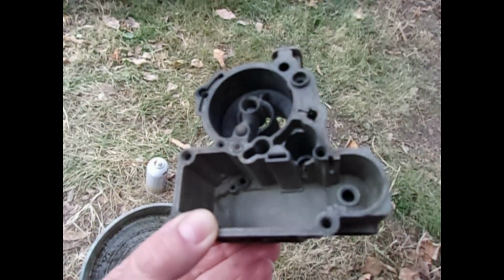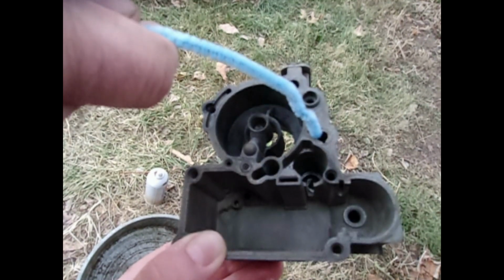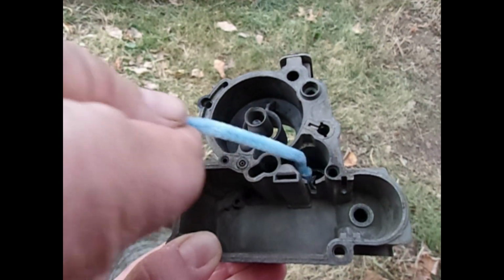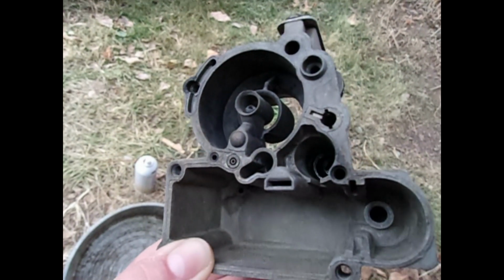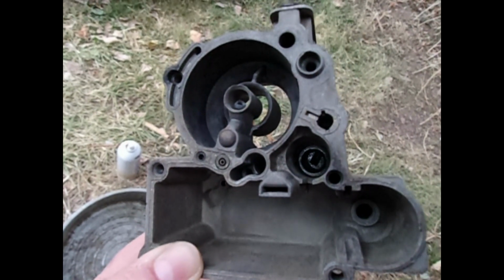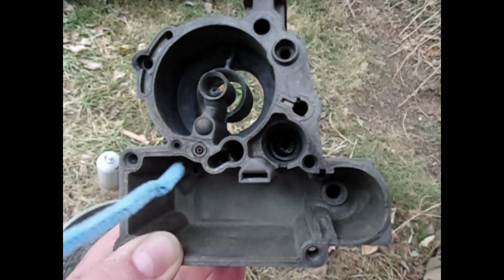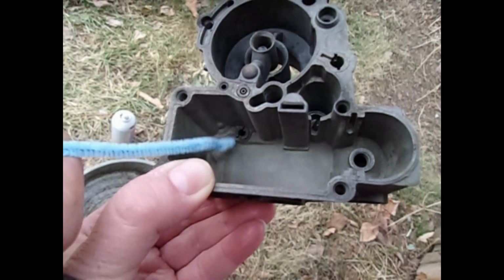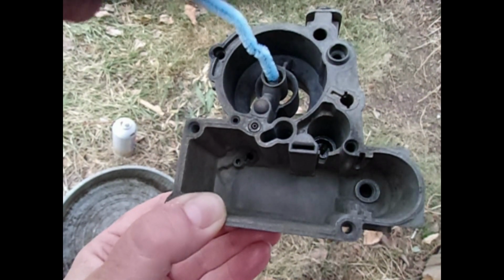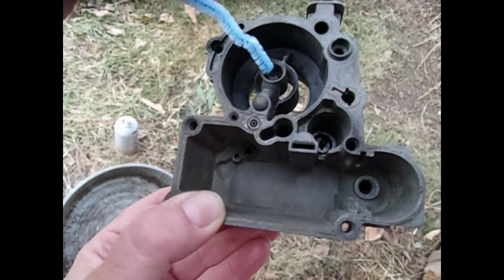Okay, so I've tried spraying down here, and it comes out down there, but it's swirly. It's not a solid spray, but it seems like it's constricted or restricted. For comparison, I sprayed down where the jet and metering rod is, and it comes out in a solid spray. It's not great, but it works out here.